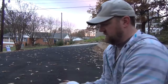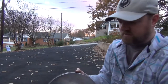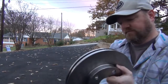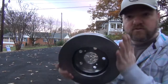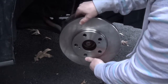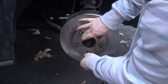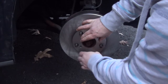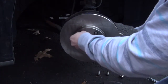Now that I've sprayed it down, I'm just going to wipe all the extra brake cleaner off. You just want a nice clean surface for the pads to come in contact with. Remember, wipe both sides. New one goes on just like the old one came off. You may want to get one of your lug bolts and just put it on here just to keep it in place until you get the caliper on. We'll do two just to be on the safe side.